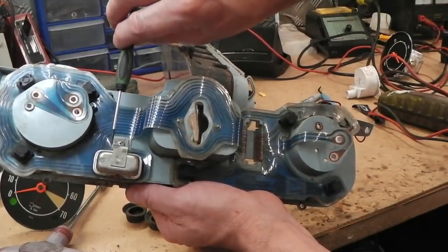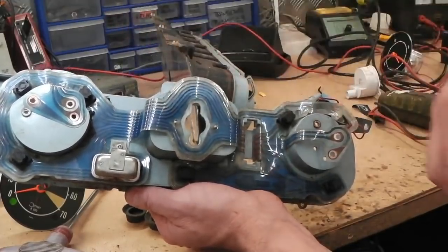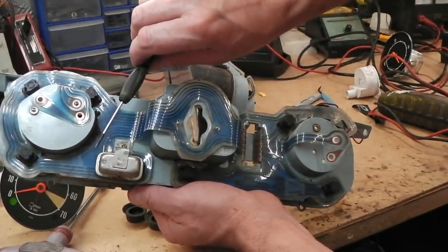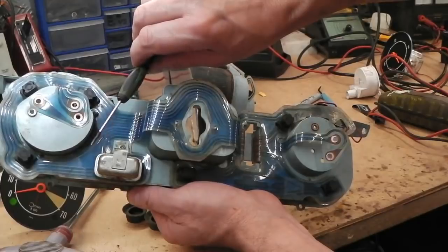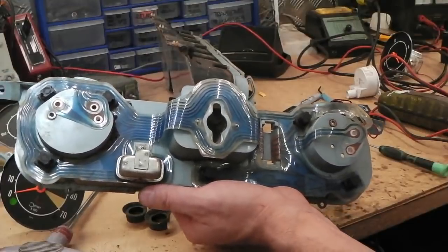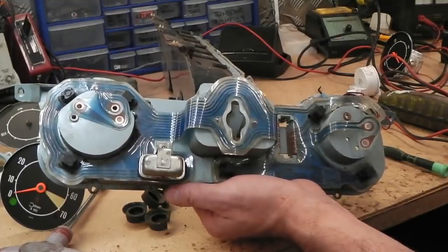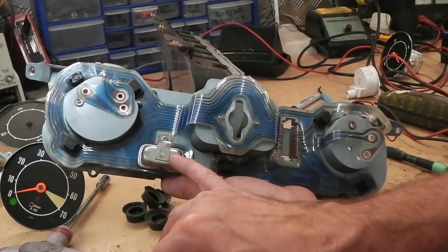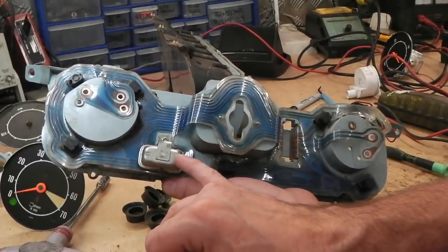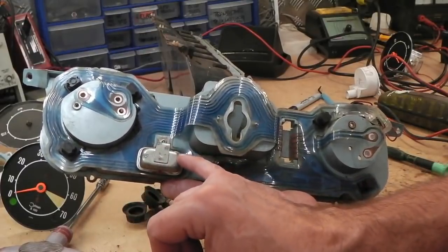It just wanders a little bit like this, but it will stabilize wherever the temperature probe on the engine or the fuel sender in the tank is sat at. So it never really moves around, and this just constantly gives it a little burst of power, and that smooths out the operation. That's a voltage regulator. Does it actually create 5 volts? It doesn't create 5 volts. Some later ones were replaced with 5 volt regulator units taken from a different system, although it was in the same footprint and shape, and you can actually retrofit them.